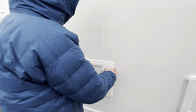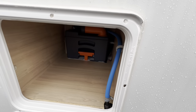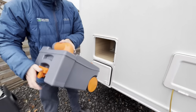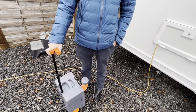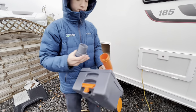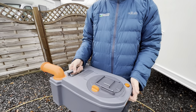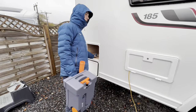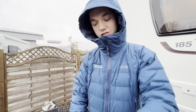This is your cassette — push both catches in. To get the cassette out, lift the orange handle and pull it out of the van. To empty it, carry it or wheel it to the waste disposal point, which is normally beside your toilet block. Take the cap off, press the orange button and tip the contents out. There's normally a tap there, so put some water in, give it a final rinse and tip out again, then go in with a cap full of either green or blue chemical — if using the liquid, 120ml either measured or by eye.